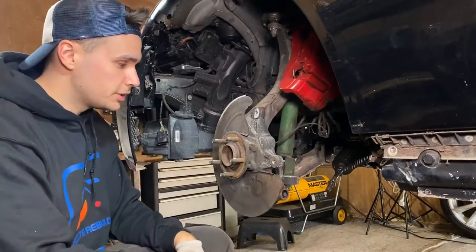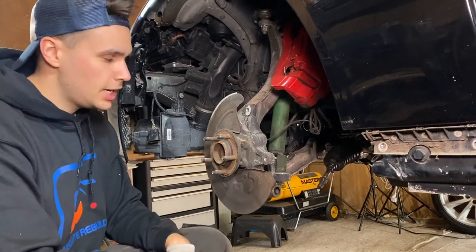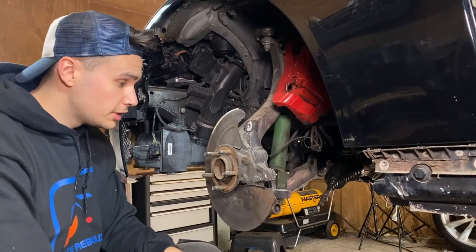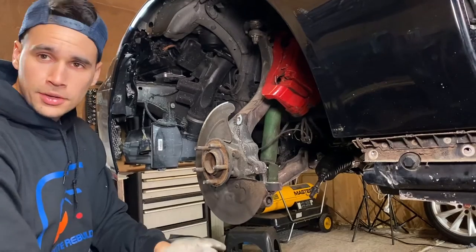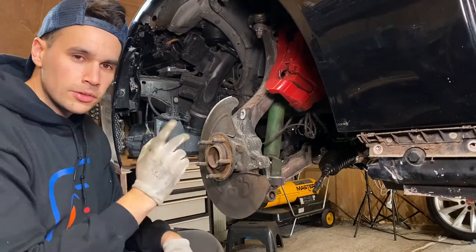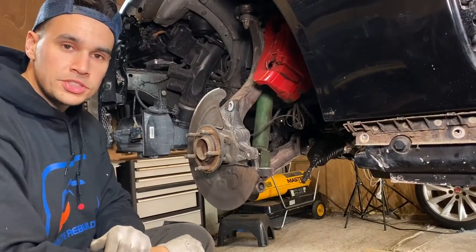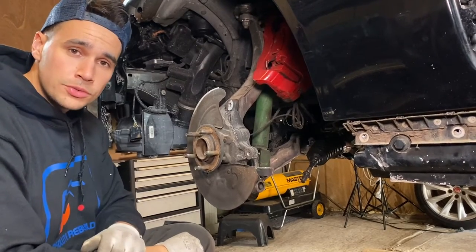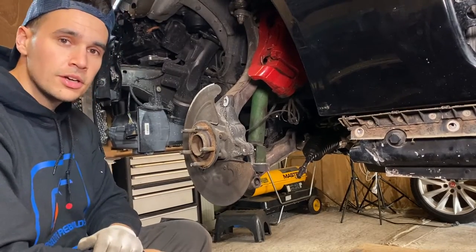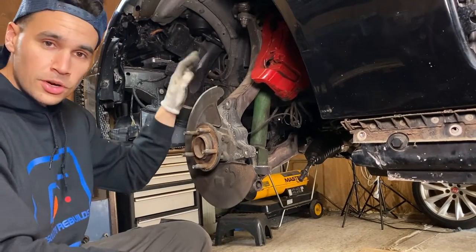So we're now at the front of the car, and I don't know if you saw our previous video, but we had a little bit of a struggle with the tie rods. We got some new tie rods which were 14 millimeters, and our old tie rod here was 12 millimeters. So we first thought we got the wrong tie rods, but apparently this complete control arm is from the previous Jaguar. It's from the pre-facelift or from the 4.2 liters. Well, we have the after facelift from 2010 with the 5-liter V8. So then the question rose, how come we have the complete wrong arm?